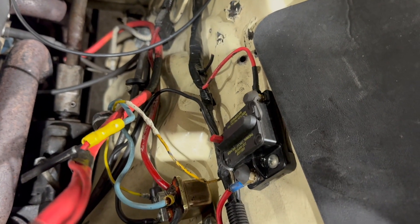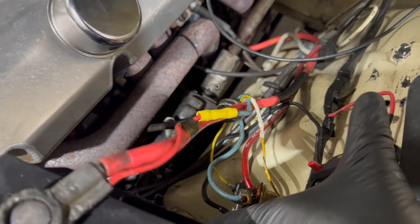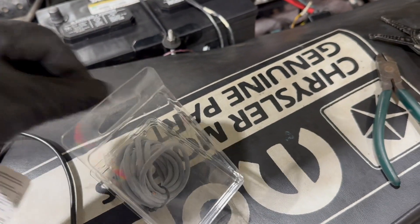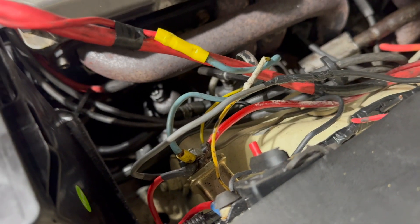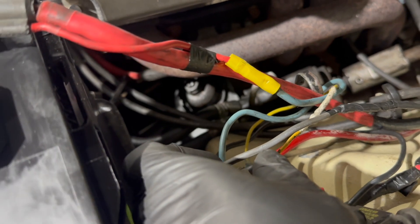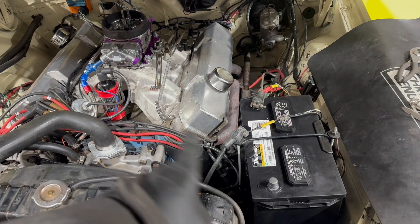We're routing wire now. This particular car actually has this big main breaker, and I could just put the charge wire on the same side as the feed wire to the car — in theory that would work, but I don't really like it. So I'm going to stick with the fusible link option. I'm going to get a six-inch long section of it, hook it to this stud, and then splice it onto the wire. The rule of thumb for a fusible link is that it should be two gauges smaller than the wire it's protecting — that's another reason for picking the 10-gauge wire. This 14-gauge fusible link is all you can buy in a parts store these days. Make sure you disconnected the battery for all of that.